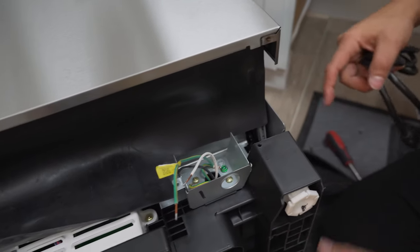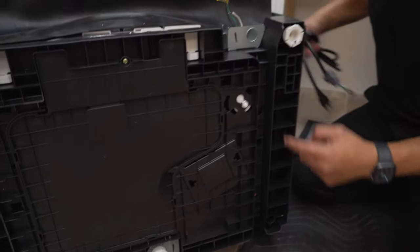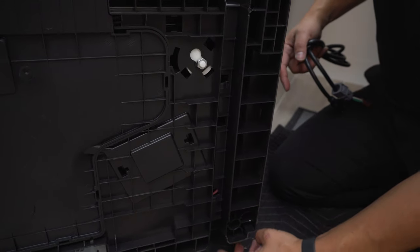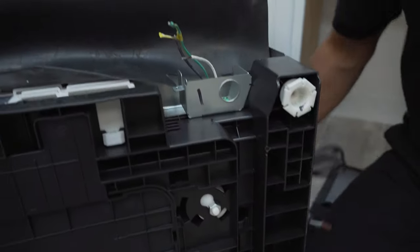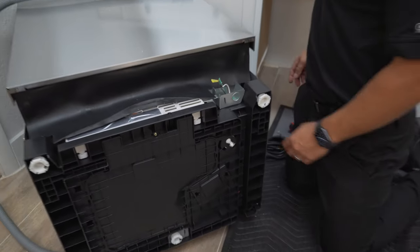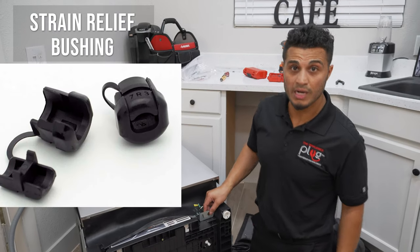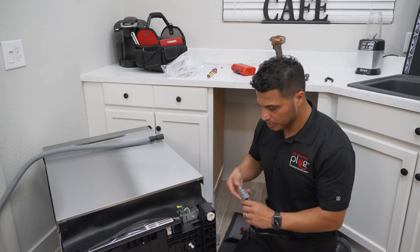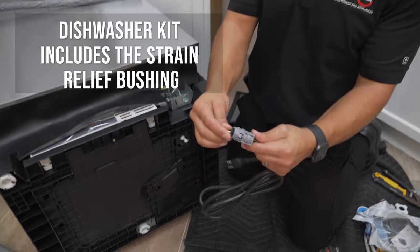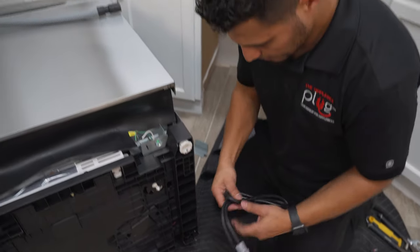This is the track that you're going to be able to use. If you're doing a hard wire connection, you're going to need to run your electric line from the backside of the walls behind the dishwasher, run it up through here to this box. You're going to need an additional part that connects to and secures to this electrical box. I'll include the description of the size that you'll need. On our power cord, ours comes pre-attached, so we don't need that here, but let's go ahead and knock this out.